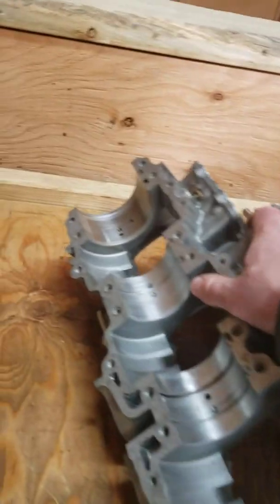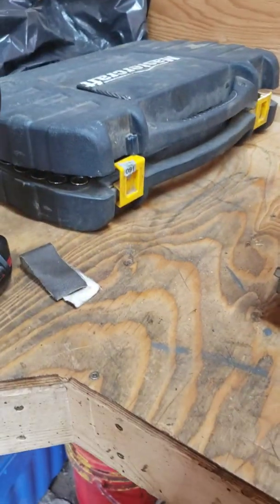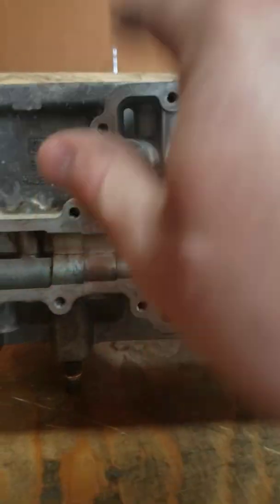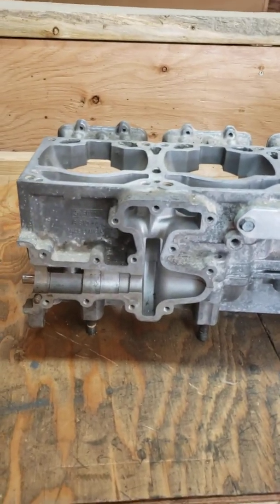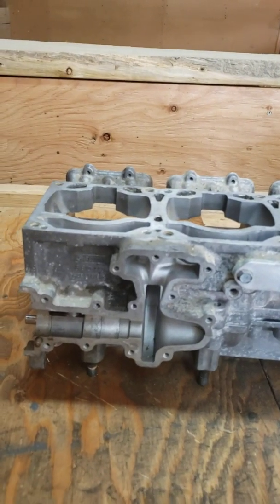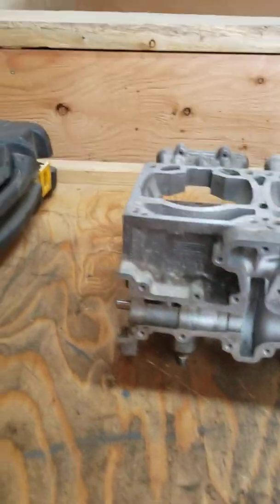While you have the bottom end apart, you might as well check the water pump. On the 600 and 700, the water pump sits right in this channel and pumps coolant into the base of the cylinders and out through the head. On the Mach-Z it's different - it pumps through a tube to the head with a slightly different coolant path. To service it, take the ignition cover off, undo all the bolts, pull the pump cover off, and take the pump and shaft out. There'll be three seals and two bearings - replace the bearings and do the seal kit.